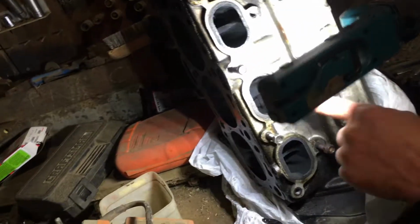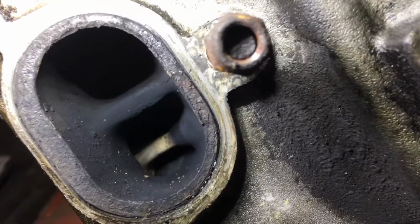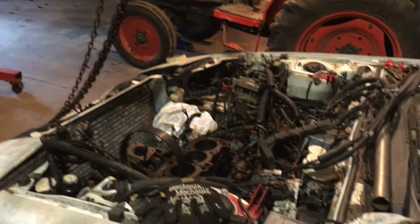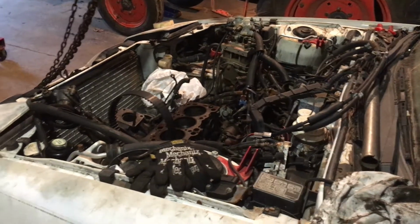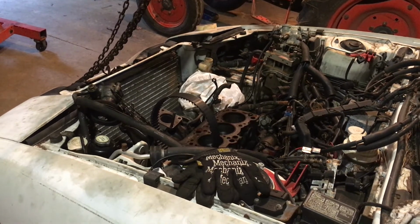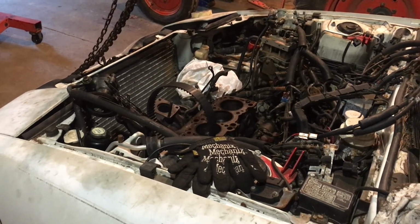But on the number two, you can see way down at the face of the valves on both of them, where it's a little bit oily. Now that's probably an indication it may have been burning some oil. Usually on the face of the exhaust valves, if they've got some pitting where the valve face meets the seat, that's a sign it's burning oil, which is probably a sign that the rings may not be seating as well, but you don't know that until you look at everything.